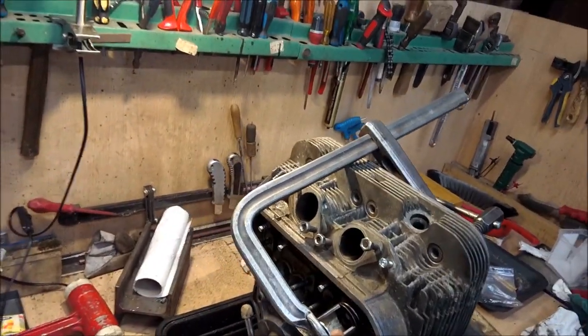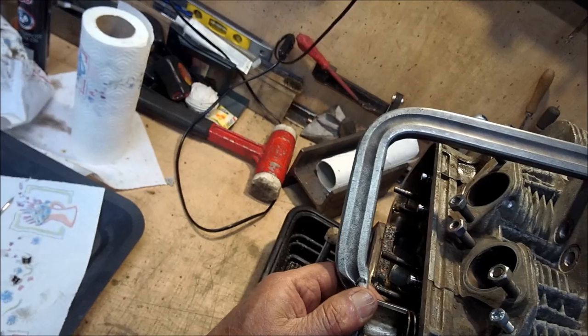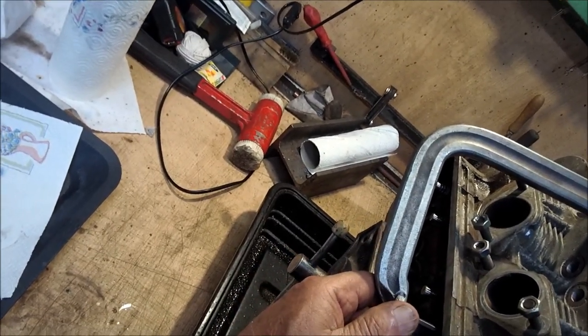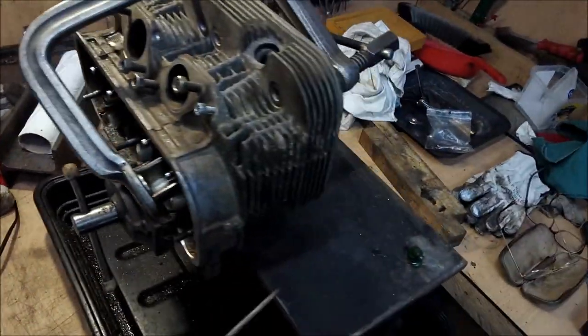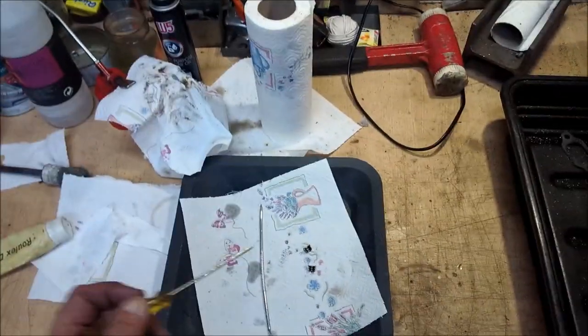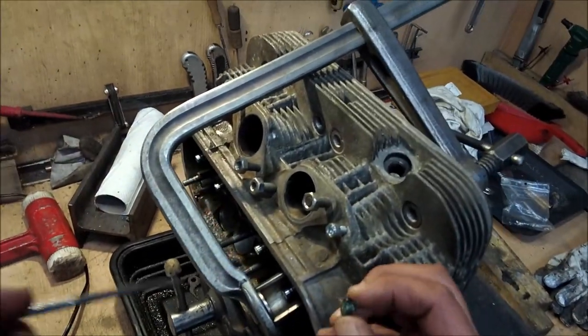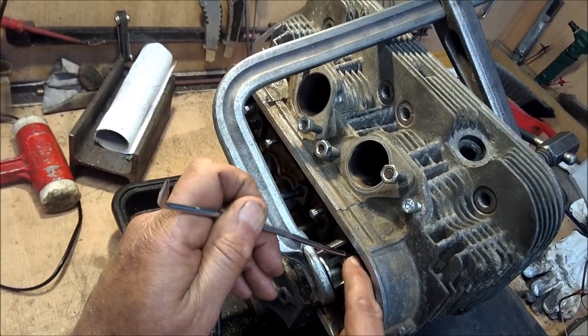We close the spring down, open the gauge up until you can see clearly what's going on. Then we're going to put the little collets in - what I do is have a little dab of grease, and these are magnetised so that makes life that little bit easier. Live demonstration - hope we get it right first time. A little bit of grease on. That's one on.